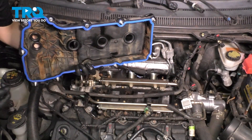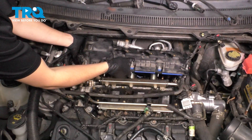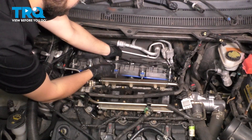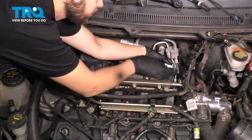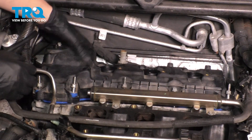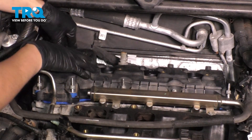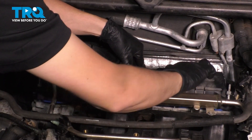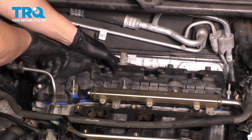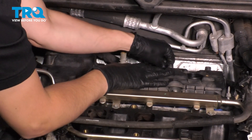When you install your valve cover, make sure the gasket isn't falling off. Take the valve cover and slide it on — be very careful so you don't pinch the gasket or cause it to fall off. Line it up the best you can. Make sure the wiring harness at the back isn't getting caught. Feel around to make sure the gasket around the perimeter is still secured and attached to the valve cover. At this point you just have to line up the VVT solenoids — they move around a little bit which helps you line them up, but they still need some persuasion. Push down and do the same around the spark plug tube seals. Once one or more mounting hardware pieces line up, thread them on — I'm going to start all of them in by hand before I tighten any.